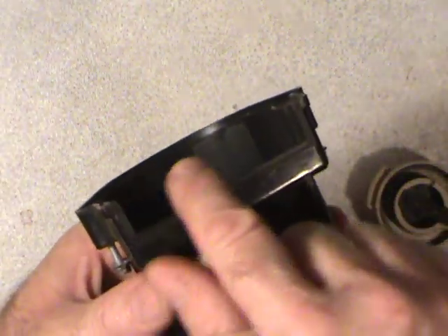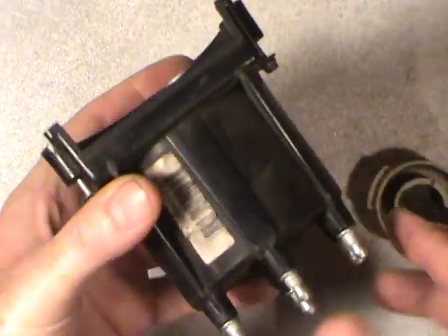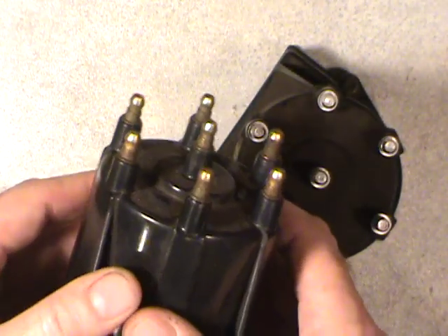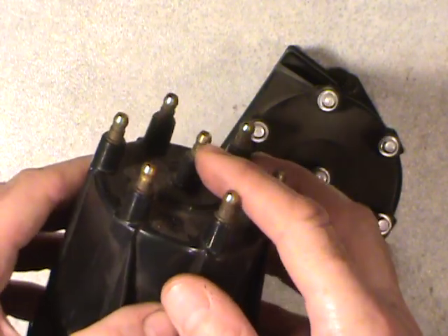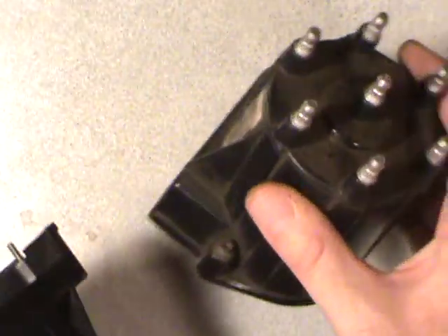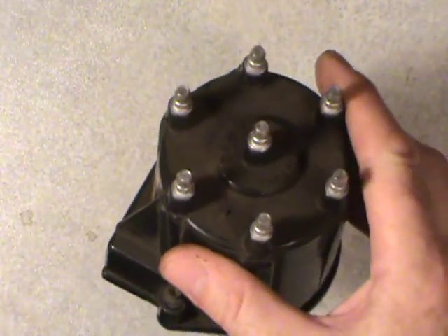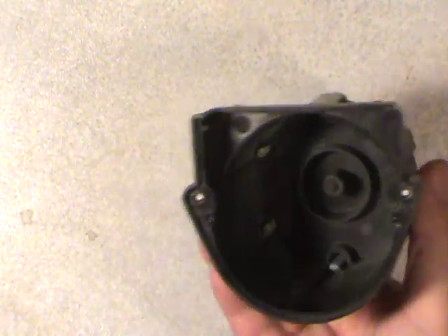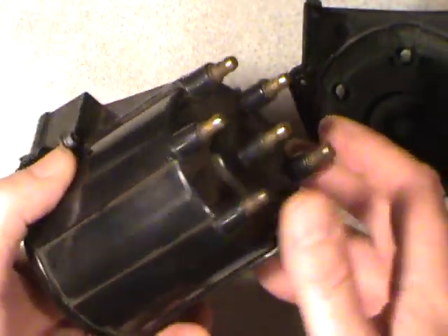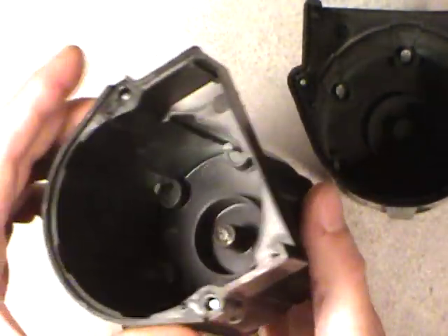There's a cutout here for the ignition module — future videos I'll show you the rest of the stuff that goes in there; that's why the cutout is there. There are also two cap versions you can get. This one has carbon pins where the spark plug leads and coil lead attach, and inside it's all brass. The cheaper ones and original equipment usually had aluminum. They erode a lot faster, but honestly that little carbon button is going to wear out first before anything else anyway. If you want to spend a few extra bucks on the brass one, brass is probably the more professional material for high-voltage applications.